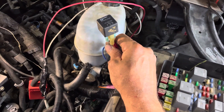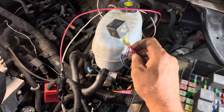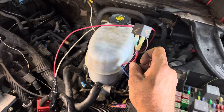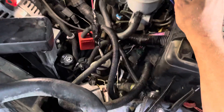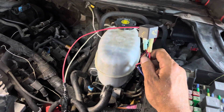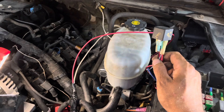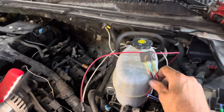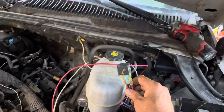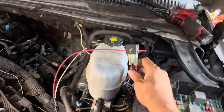In essence, what you're doing with this is a circuit-protected relay that you can use, and you find the fuse for the trailer brakes on your fuse block. The relay keeps it so you can run that maximum amount of power — it was 15 amp — but it's a fairly big wire and that motor creates a lot of heat. So you can't just connect your signal wire in there or you'll melt it out and blow the fuse. Essentially, what you're doing is the truck believes it's controlling a trailer with electric brakes on it.